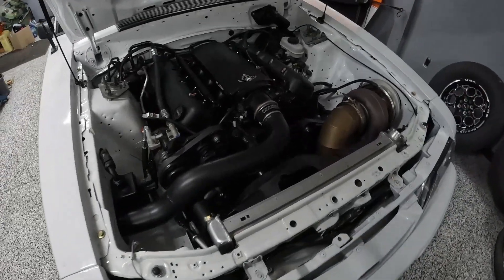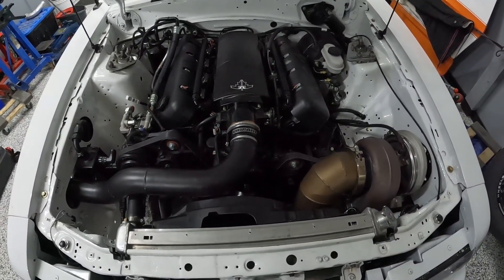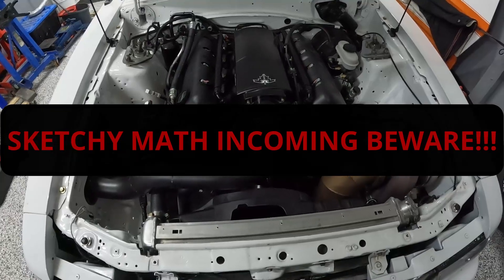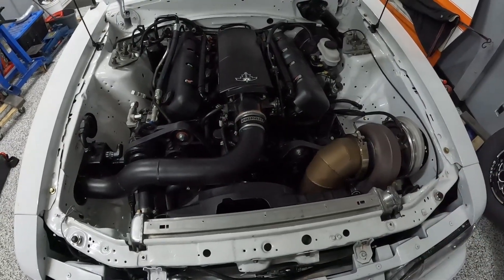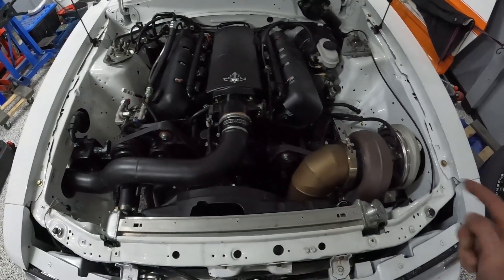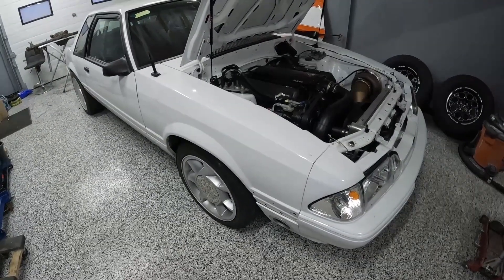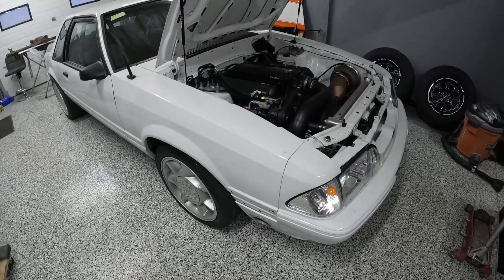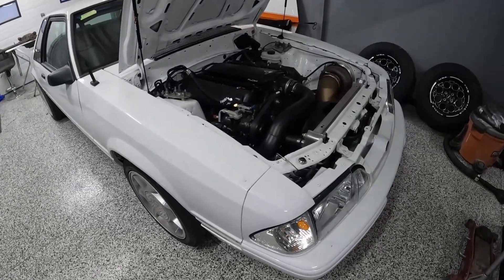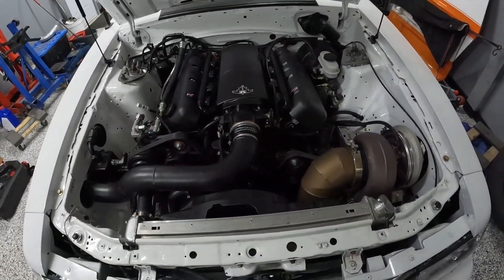So essentially what's happening is there's less fuel to burn when you have high back pressure, and the more fuel you can burn the more power you're going to make. On the power topic — what else have I seen? This particular turbo at 6 PSI is already using 388 pounds per hour of fuel versus my Camaro at 16 PSI using about 415. So this turbo is providing so much air to the engine that total fuel usage is already getting close to what my Camaro was making at max boost, and I don't even have the boost controller turned on yet. This setup is going to shine at the track — I want this car to go through the traps at high 6,000 maybe 6,700 RPM at 150 miles an hour, probably requiring around 800 wheel horsepower, which I'm hoping to do on E85.